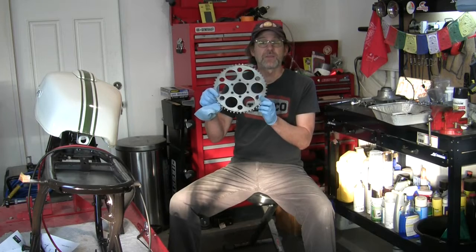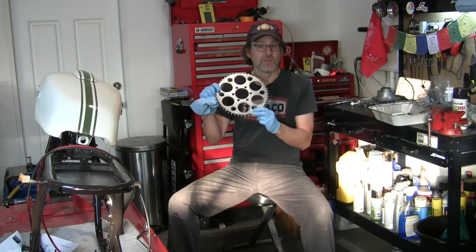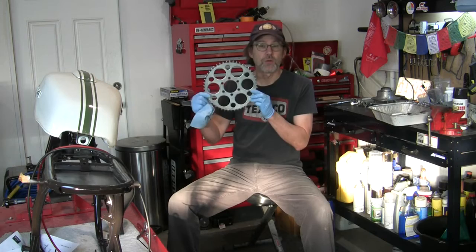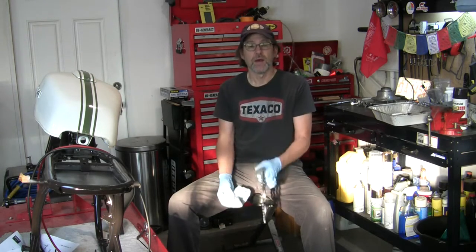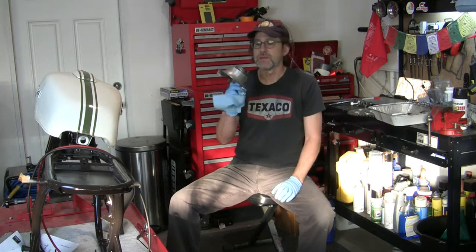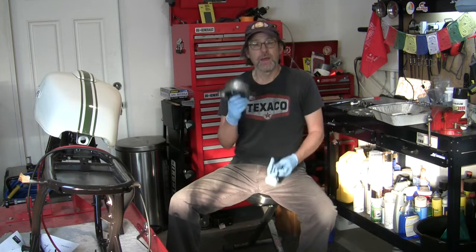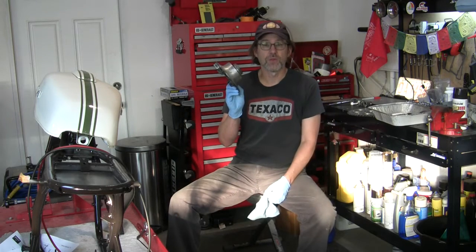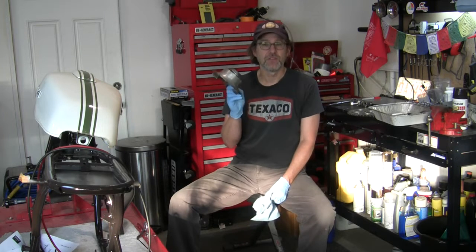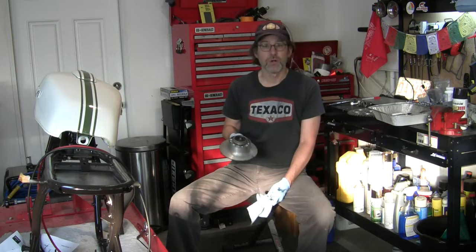On second thought, I am not going to try to polish this because as I look at it closely, it's a steel sprocket and it's galvanized. So you're not going to really polish galvanized. But we got it cleaned up. It's looking far better, and we'll have some nice shiny parts around it. So, sanding. We're going to polish this up, and I've got to check my bearing here. That's really solid. I'll be reusing that. Same thing as I did on the carburetor float bowls and the covers: 600 grit, then 1500, then 2000, then the aluminum polish on the buffing wheel. That's pretty much my protocol.